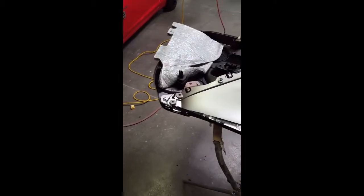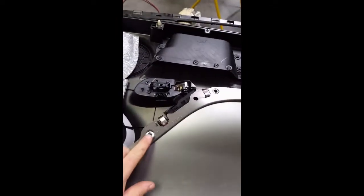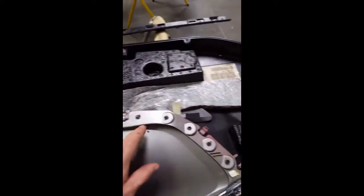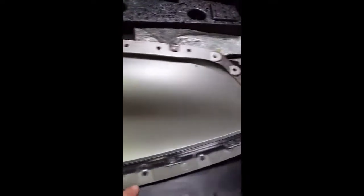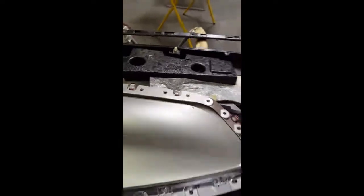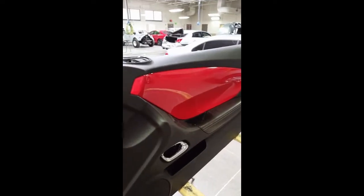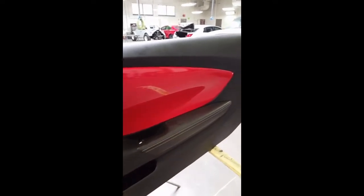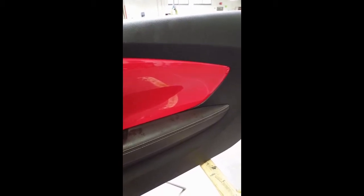Okay, so I've set in the new painted panel. It is just roughed in right now. Got a couple screws holding it in place. I'll eventually come back and use a panel bond structural adhesive to basically recreate where these rivets got shaved off. But the end result is a nice red piece that will, like I said, once again, bring the color into the actual car.